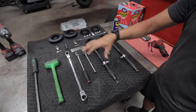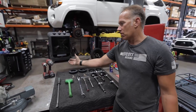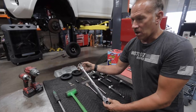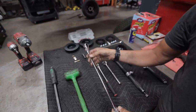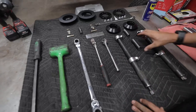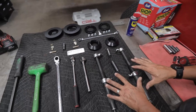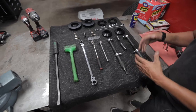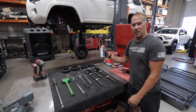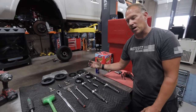These are household tools right here, so if you have these tools it will make it very easy to install. We also have power tools which is what we're going to use today. The tools you'll need are a 21mm and 22mm wrench for the lower cam adjuster bolts, two ratchet wrenches, a 19 socket, 17 socket, and 14 socket, plus spring compressors, a hammer, and a pry bar. We also recommend WD-40 to help loosen the lower collar when removing or installing it.